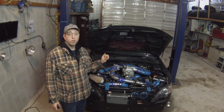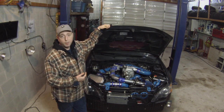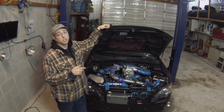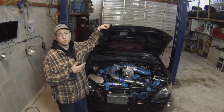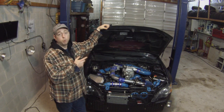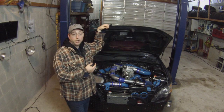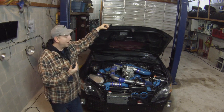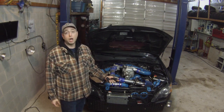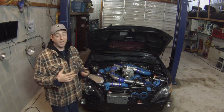Let's start this up and see if it's any better. I'm going to compare it to the AFRs on the wideband because they were conflicting the other day. Normally my O2 sensor would work right off the bat — it would show readings when I started the car. But a week or two ago it wasn't doing that, pausing for the first minute or so. Then it went back to responding immediately, but at idle the readings were at least a full point to a point and a half off — my wideband said I was idling at 16, and the factory on my scan gauge was saying 14.7.